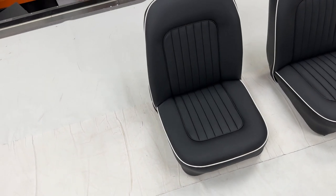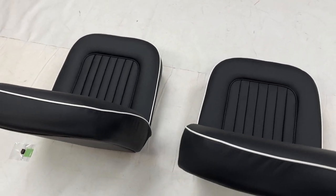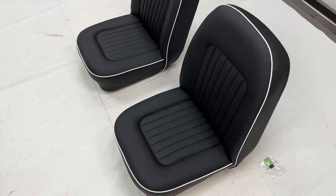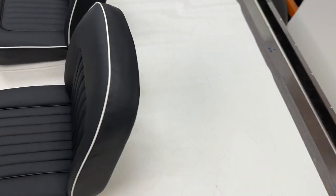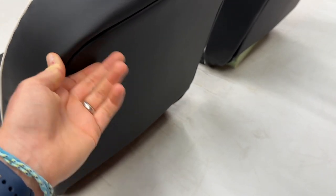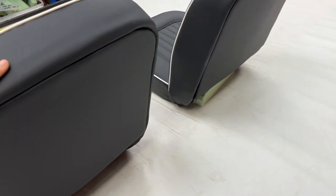It's pretty obvious from when you lay the covers out which is right and which is left based on the narrower horseshoe. But if you're unsure, look for little triangles cut out in the bottom of the horseshoes and the bottom of the panels — that is our way of indicating internally which is the right hand seat. The triangle means right hand; no triangle means left hand or universal. This hardboard back panel was introduced on the TR4s, carried on through the TR4As. The TR5s dropped it, then it was reintroduced for the TR6 models up until the very last version.